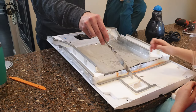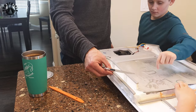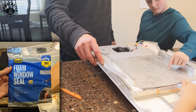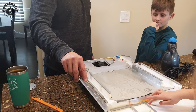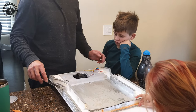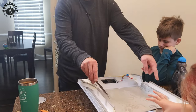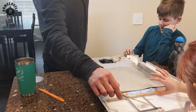The second thing I did: removing the fan assembly can damage the factory gasket, but I think the gasket wasn't working well everywhere in the first place. I bought the thinnest possible foam weatherstripping from Home Depot. The adhesive isn't super aggressive, so you need to put a small drop of CA glue — super glue — every couple of inches and set it down onto the existing foam. You could also tear off the existing foam and start from a clean substrate. Adding this foam should direct air where it needs to go and keep moisture out.